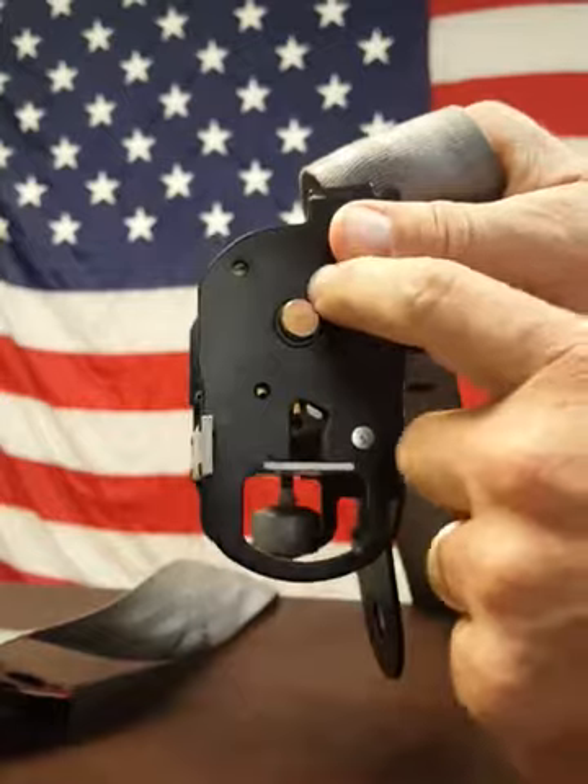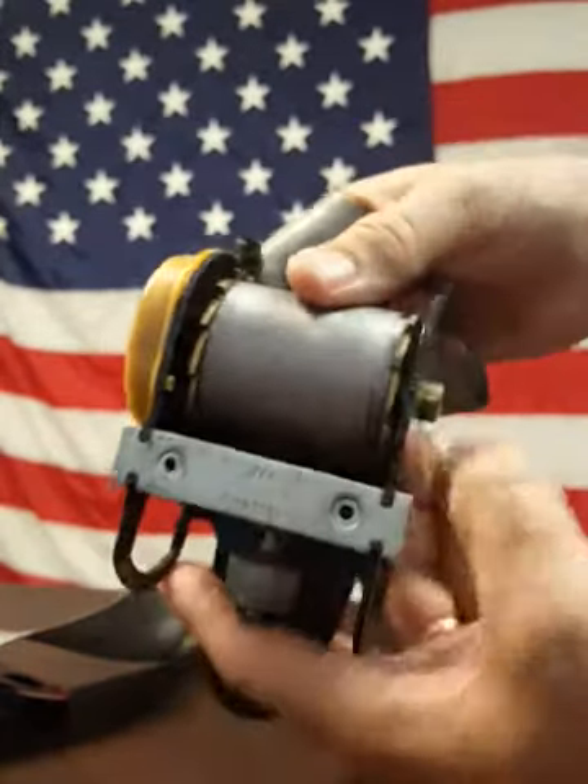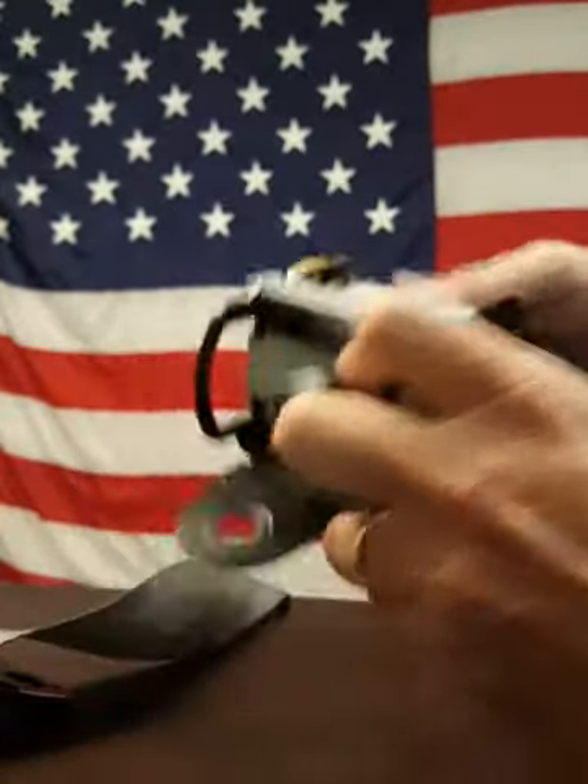Normally, if it was designed to lock by speed, it would have a centrifugal clutch on the outside right here, and this type of retractor in that car did not have that. So even if you tilt it on its side and yank on the webbing, it won't lock.